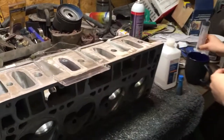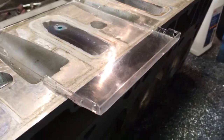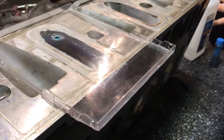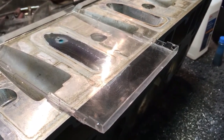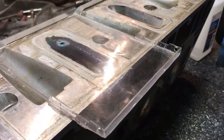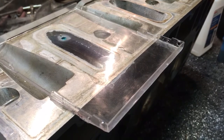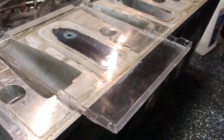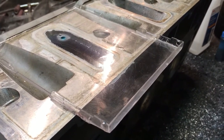Let's take a look at the port. These are the 241 heads. It's got 200 CCs. The factory rating for this as-cast 241 cylinder head is listed as having 200 CC runners. We'll put 20 more CCs in there and see where we come out. Basically, we're at the factory-rated 200 CCs, so anything above that would be a direct result of our porting efforts.